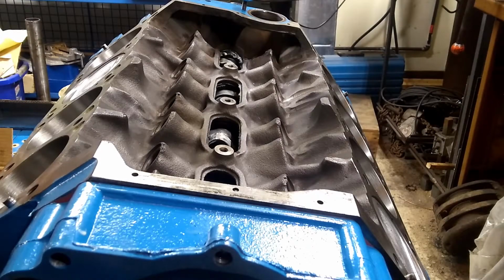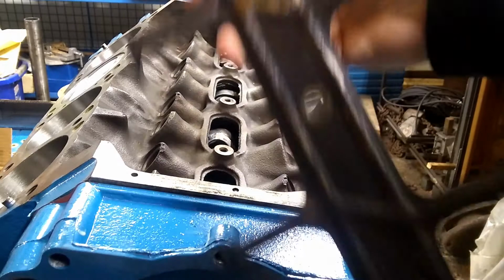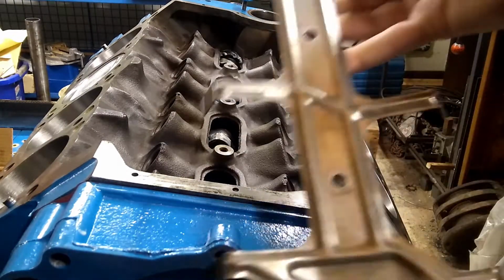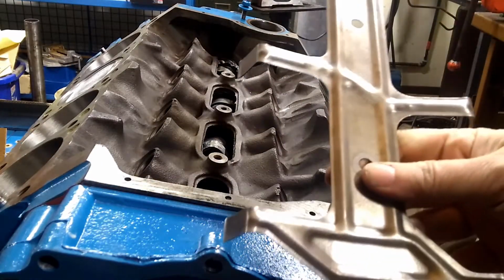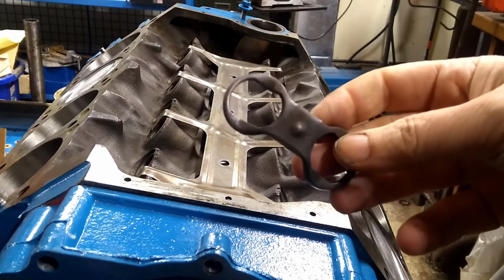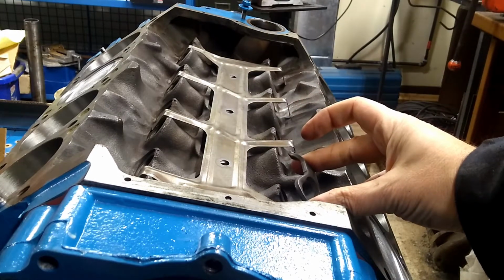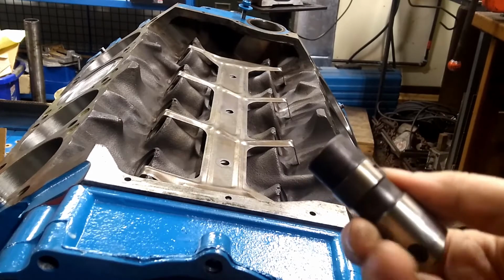Really, it's just a lot of cleaning work, time at the bench grinder and the wire wheel, getting parts that look like this to in turn look like this. So really what I had to do was get this clean, so this sits here, clean up a bunch of these dog bones. These hold the lifter's orientation properly, then clean up enough lifters to do this.